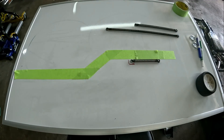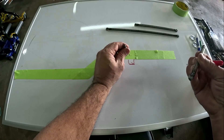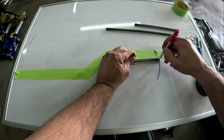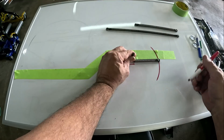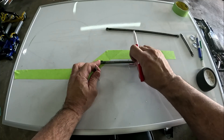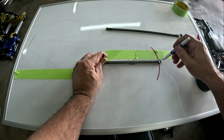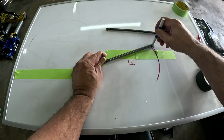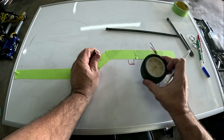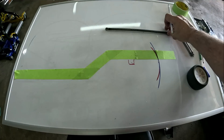We'll take the first link and mount it off your leaf spring mount — that makes fabrication pretty easy. We'll hold it in its space and look at our swing. There's our arc — that's how the rear end moves with a short link. So let's go to a longer arc. I've told people to run the longest arc possible, so we'll pin it in its location and look at the new swing arm. The longer arm is now pulling the wheel less, so the rear end moves less. If you put horsepower to it, that horsepower is going to react less.